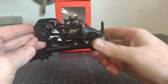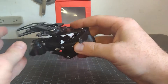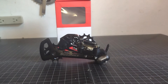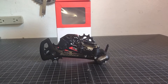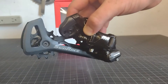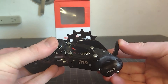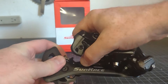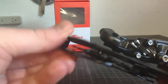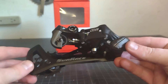There are two caveats to using this derailleur, and I think both were covered by Russ in his Pathless Pedaled video about this rear derailleur. The first is that there's no barrel adjuster, so you'll need to get one to adjust cable tension and index your gears correctly. You could put one at your lever if you have external cable routing, at a cable stop on the frame, or into the rear body of the derailleur like I did. A pair of these should cost less than $20. At the time of this video, the Sunrace RDM900 can be bought for anywhere between $30 and $45 US.